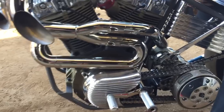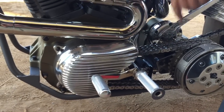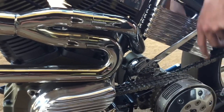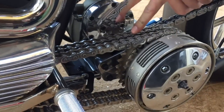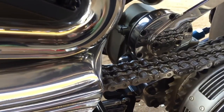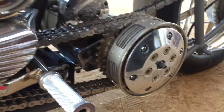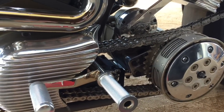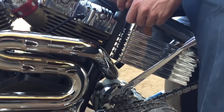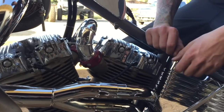Who makes that cover for the chain? Throwback Cycle Parts make that — yeah, throwback. They make the rocker boxes and the side cover there. It's all in-house built primary. It's a pan-head clutch basket. It's got Martin sprockets that are machined out. It's got a BDL drive conversion on the front side with two sprockets bolted to it and a BDL competitor clutch system in it. And you do all this engine and transmission work yourself? All of it in-house. I don't source anything on it at all. All grade 8, 12-point hardware on everything.